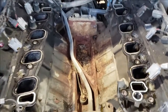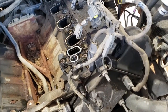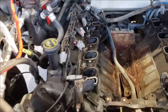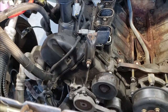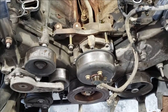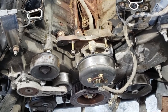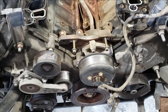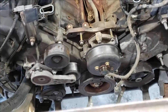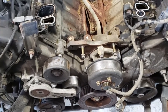Got to do some cleaning up and vacuum all this stuff out. We're going to clean both sides up. The wiring harness for the fuel injectors — we'll get that loosened up and tucked back out of the way so we can get the valve covers off. They've been leaking so we've got new gaskets, and we'll also need them off because we're doing a timing set. All the stuff on the front of the engine has to come off — we've got a water pump, timing set, and also an oil pump. Once you get the front cover off, you're staring at the oil pump, so there'll be no reason not to change it.